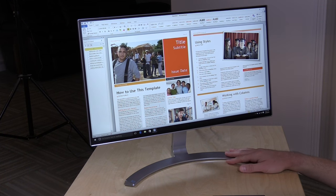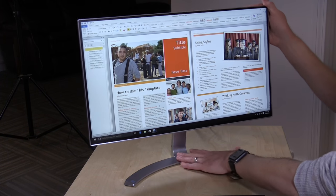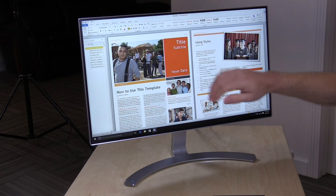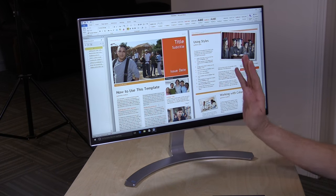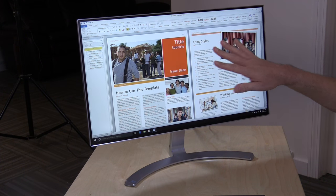For gamers, you may not have the best monitor here. This has a 5-millisecond response time — gamers are typically looking for something in the 2-millisecond range. It runs at 60Hz, which is fine for movie playback, but if you're a gamer looking for 120Hz, this won't be your monitor. There's no portrait mode either. It has a 1000:1 contrast ratio — pretty much a standard, run-of-the-mill monitor, but with really nice looking bezels.